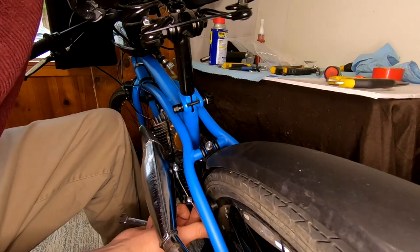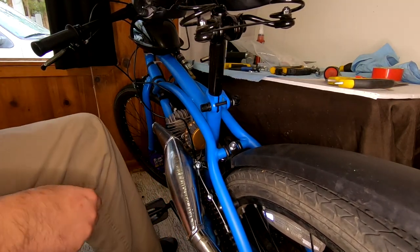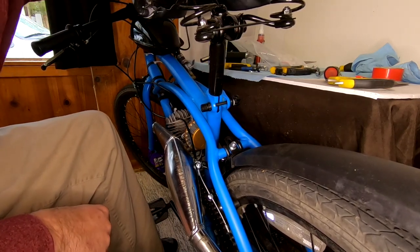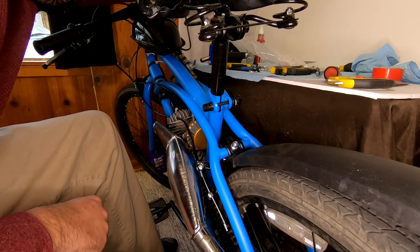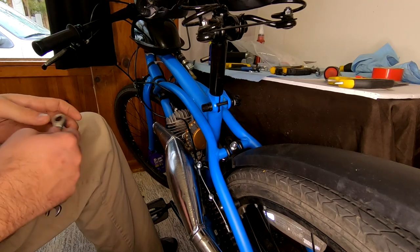I also really don't like the F2 thruster for the fact that all of this mass is hanging off of your cylinder and bouncing around. This can definitely pull out the studs and destroy your cylinder if you don't secure it to the bike. As of yet, I still don't have a solid way to secure it to the bike, but I'll have to think of something because I can't run it like this for too long.